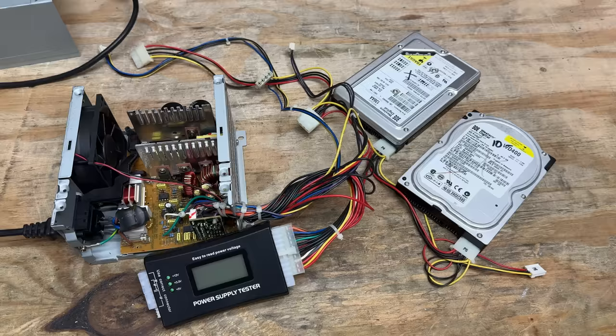There is no way that motherboard tray is not removable - it's just way too tight in there, and there's no other way I can see to get to these drive screws. We've got two screws at the side and two at the back, although one is missing. And yeah, that thing's removable. Sure wish I would have known that before I pulled that double-jointed move to get that RAM out. What's interesting is this thing can actually be removed with all of the peripheral cards still in place, so you can pull everything out in one go - that's a neat party trick.